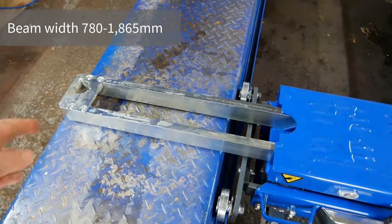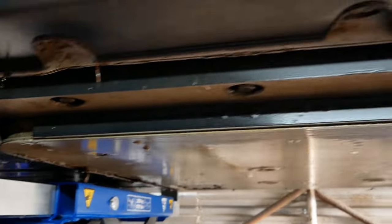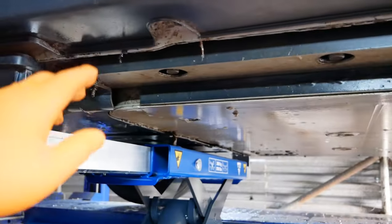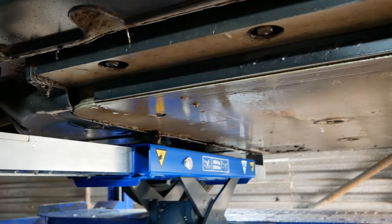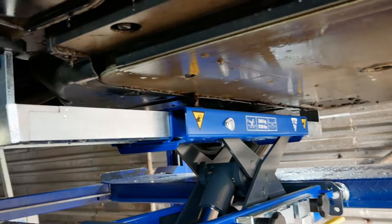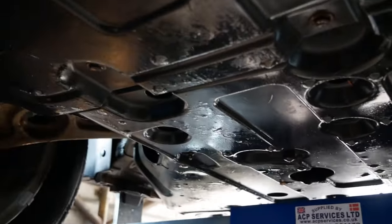That's plenty wide enough for any electric vehicle, and as you can see they span the width of the four post lift. Here I've got a Hyundai Kona electric on the lift, and when you've got a battery pack underneath you've got to jack up in the correct places. In this case it's on the sills. Particularly with Teslas they have jacking points along the battery rails and you've got to jack up on those. You mustn't jack up on the battery pack. That's why I wanted a wide span jacking beam — to span that battery pack and jack up on the proper places. And like all modern cars the underside is covered in plastic trays so you can't jack up anywhere else at the front on this particular car.